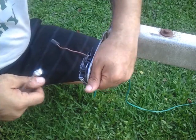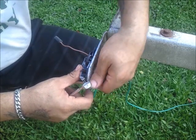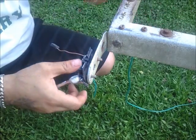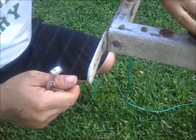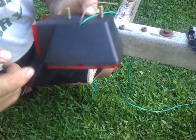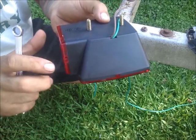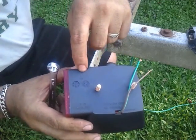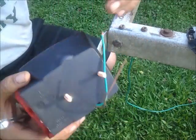Same as the other side, nothing too complicated. We're going to take off the two simple little nuts, put them there, and remove the old taillight. Simple. And if you notice, there's no clear spot, so the tag always sits on the driver's side of this. It even says curbside. It tells you literally, so this is fail proof.